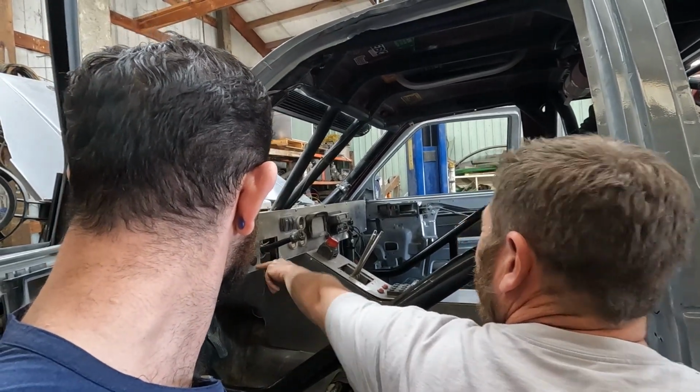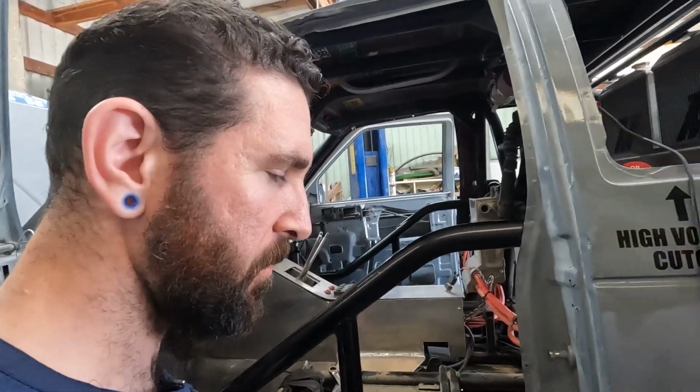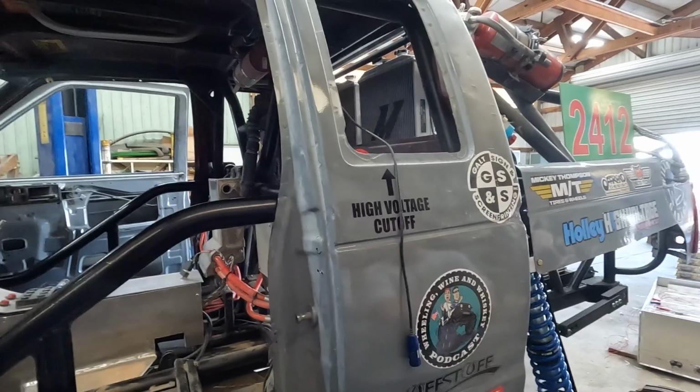And then this is your main parking brake. You just push the brakes in and lock that down. That locks the valving on the braking. That is like a tractor. Yeah, that's what I think of. Well, there's no transmission to throw in park no more. Right. So I needed a way to still park it, and we don't run a cable-assisted parking brake or electrical because it's just stuff to get in the way. Right. Well, we already have hydraulics, so why not just use hydraulic braking? Okay.